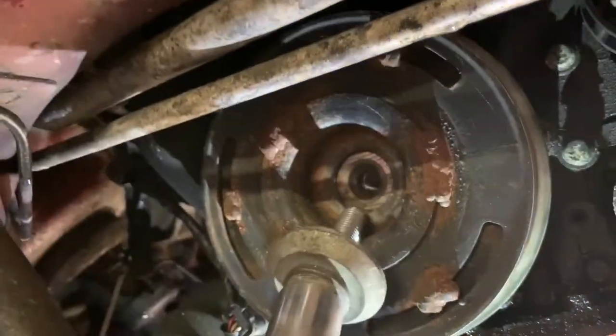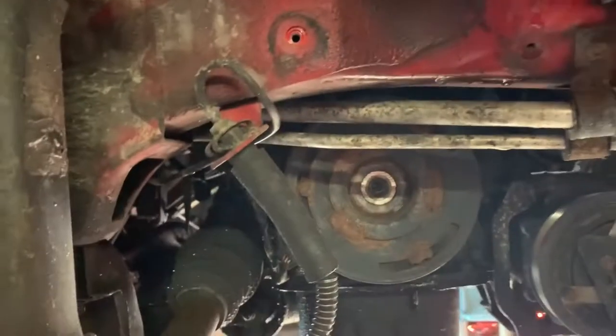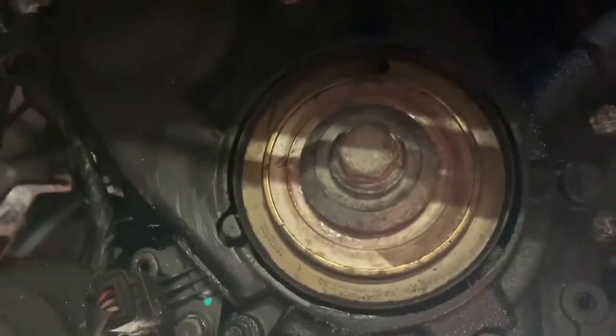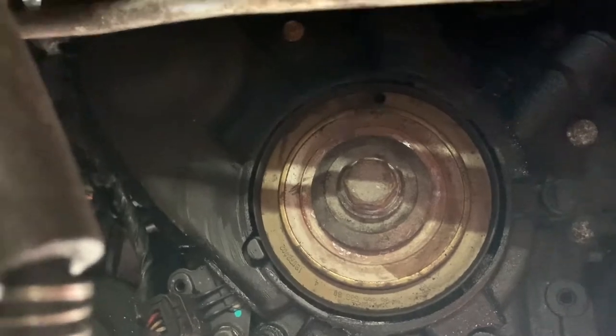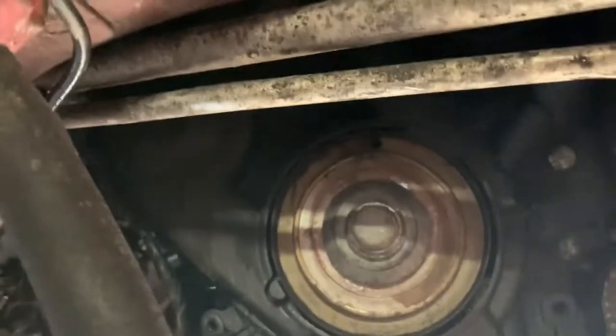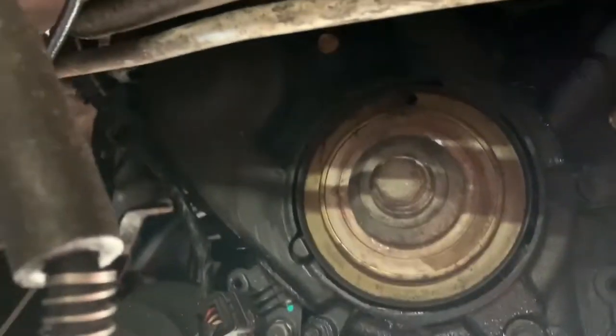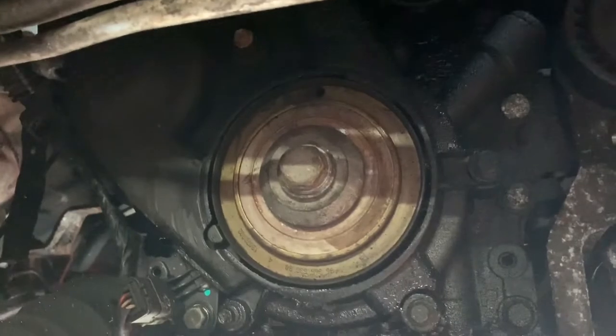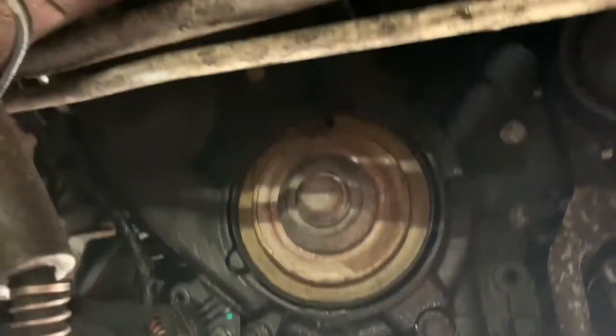Look at that. Spot on. We'll drop the bolt. Right then, well that's the pulley off. Let me just wiggle that and jiggle that and get it off. My best advice here is to always wind that bolt back in again. Just nip it up, don't gun it right up. Just a couple of dinks with the old gun, just to nip it, because you will need that bolt later on to turn the engine over by hand.